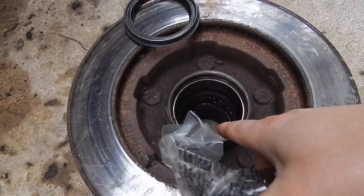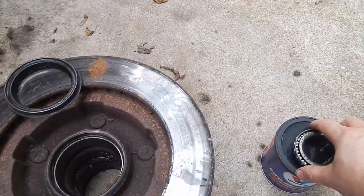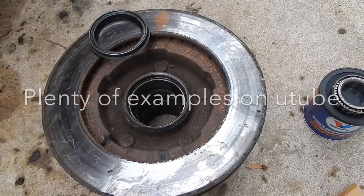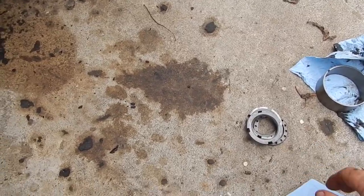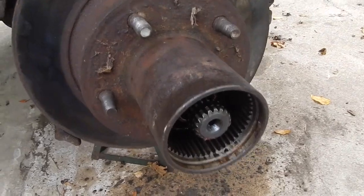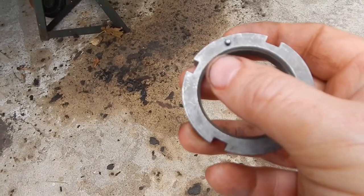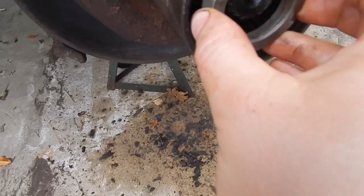A little break in the weather. What I'm going to do is repack it — put the new bearing in here, put the seal in here, tap it around the metal edge, and repack the front bearing. It's very important to know how to pack a wheel bearing — you just don't dip them in grease, you actually have to pack them. The wheel bearings are packed, the inner one is in, seal is tapped in, outer one is in. Now remember — this one here with the tab has to go in first with the tab out, because this is going to hold that lock plate.